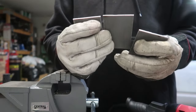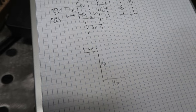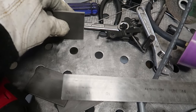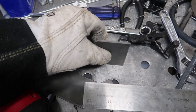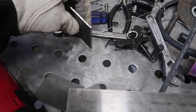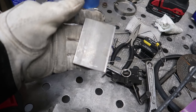We got three pieces that are all just about the same size. This is the crude drawing of what we're doing: top-down we have three pieces of metal — 20mm, 40mm, and 45mm. The 20mm piece bolts to the throttle body, the 45mm piece handles horizontal alignment, and the 40-45mm piece is where the bracket mounts in the middle. This might change as I figure it out. First we need to mark out 20mm wide and rip the piece.